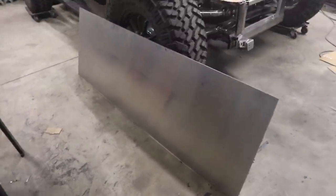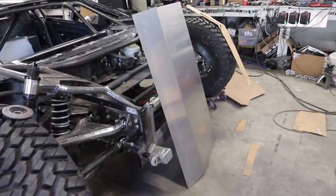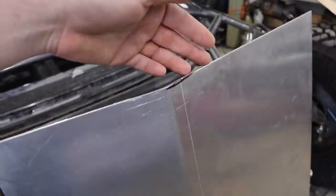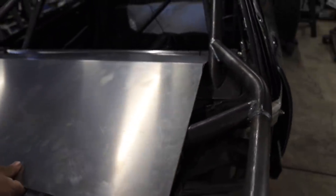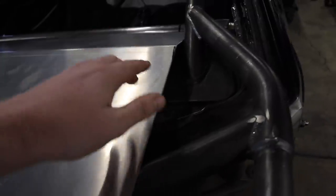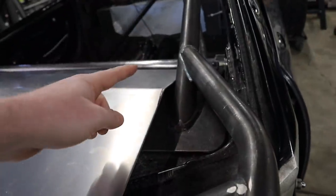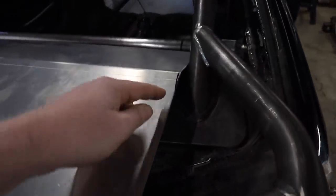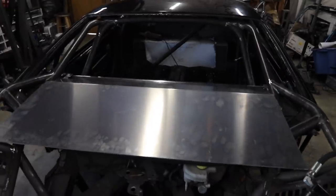It's a new day and the first thing we did was go get this piece bent - it was $25 to get bent. We got a nice perfect bend at the right angle. Now because this thing bends upward rather than staying flat, let me test fit it. This arcs up and isn't just flat - when we first cut this piece and tested it it was perfectly flat and slid right in, but the slight angle upward means the higher you get the narrower it is. So we just need to lightly sand off a little bit of material right at the crest of both sides and it should just slide right in.